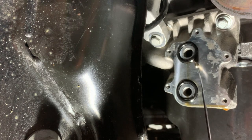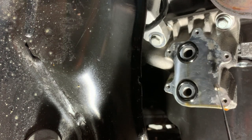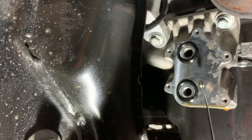They put this big casting that comes all the way back from the oil filter at the front, comes back to the oil cooler, and then feeds the oil back up through. And this actually forms a spacer for the engine mount as well. So if you want to get rid of it, like I am, you need a left-hand drive engine mount for the left-hand side, which I have. And I have now ordered the oil takeoff plate so I can put a remote filter on her as well.